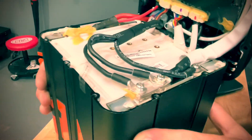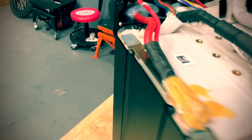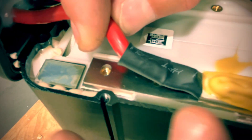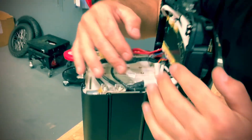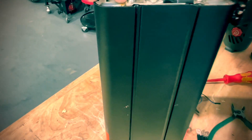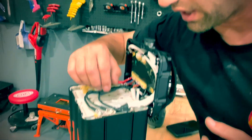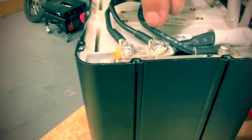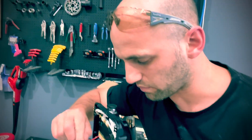We can still use this. They have four holes in this battery — one, two, three, and under here you're going to find another hole. You can see here in the red one: one insert here, another one, three, four — four total. You see this metal here from here to here? That's actually the cell terminal. This is the bus bar — they connect straight to the cells. Ideally you spread the load here as well. If it was me, I would move this bus bar to the middle and set one-two and one-two-four.